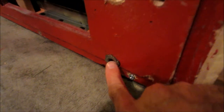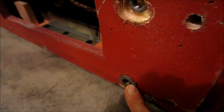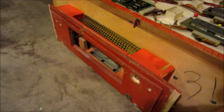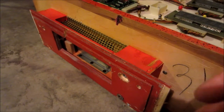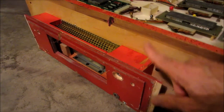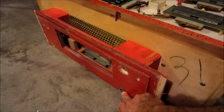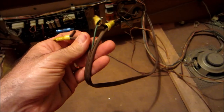I think the reason they did that is the inset t-nuts were falling out of the wood. They couldn't get enough bolts from the backbox into the cabinet to secure it, so they screwed this wood onto the backbox, bent the metal back on the sides of the cabinet, and slid it into place. What I'm going to do is take that off, attach it back to the cabinet, find some inserts, and do it the right way. Otherwise the machine plays well.